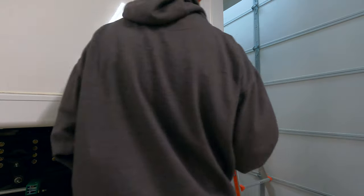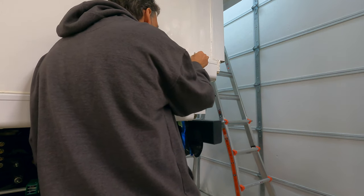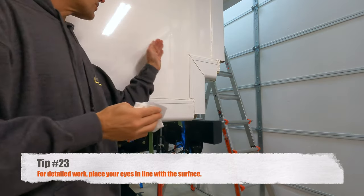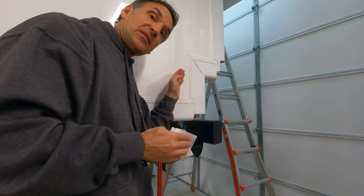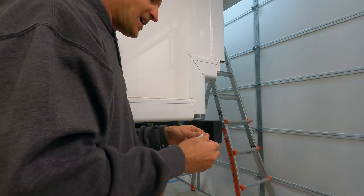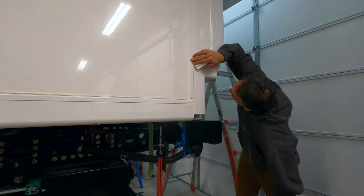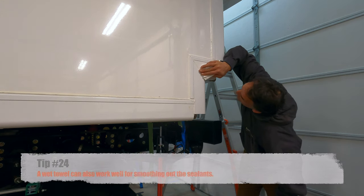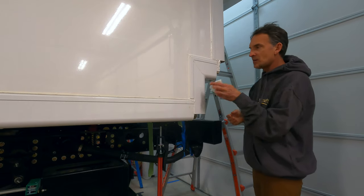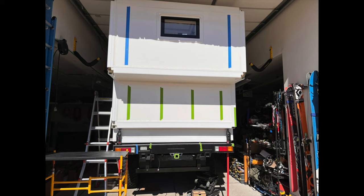Since adhesive sealants today mostly cure with moisture, using a wet glove forces it to cure quickly, which is a little precarious. So instead I'm going to use a wet paper towel with my fingers pressed into the shape I want and just gently push it in. I keep my eyes right down at the level of the sealant so I can see it clearly, making sure not to put my sleeve into fresh caulk while still using my arm to stabilize. The end result looks really great — now it's time to seal up the windows and also the interior extrusions and new panels.